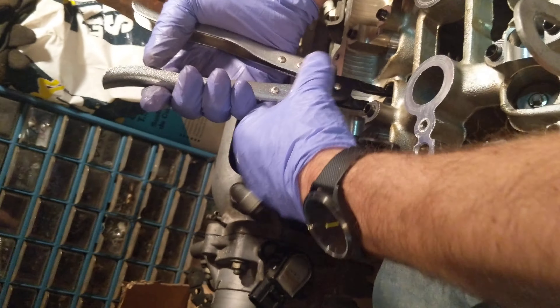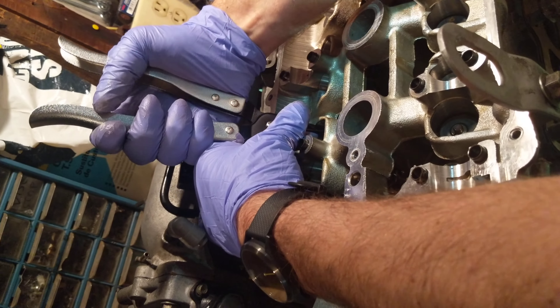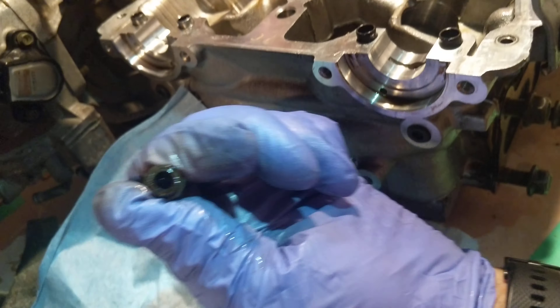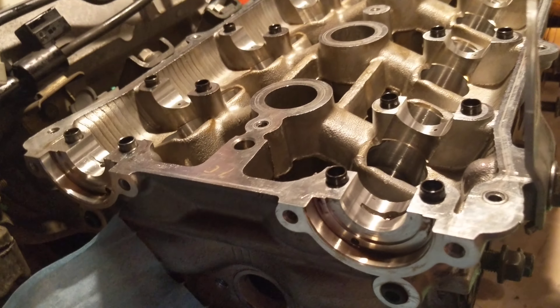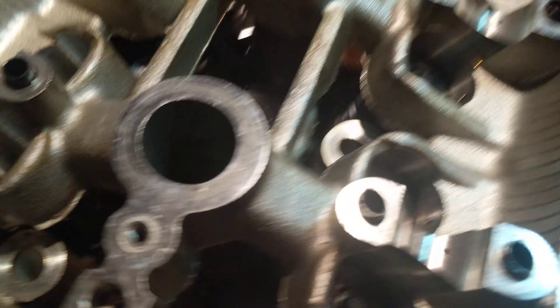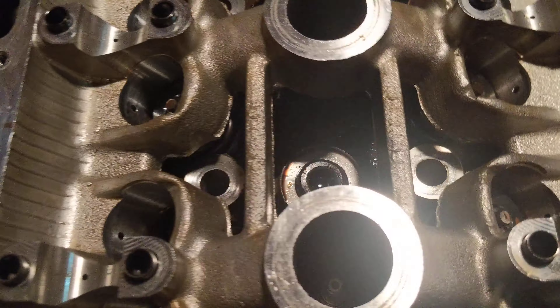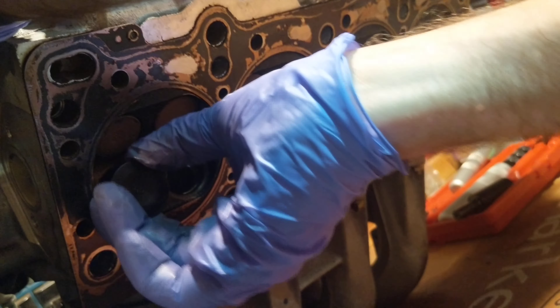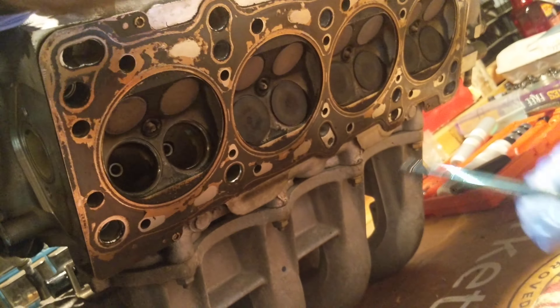I'm going to start installing the one that was already out next to it — it's just kind of my process. I'm going to have the valve soaking in cleaner in between. Pull out old valve stem seal. And we'll take out this valve — I tip it up and it's already falling out, because these seals are pretty loose. The guides feel good though.